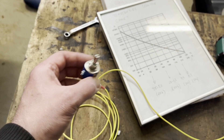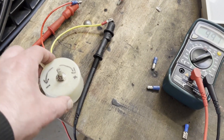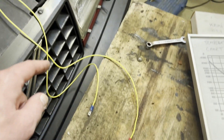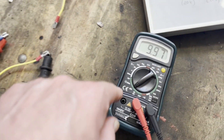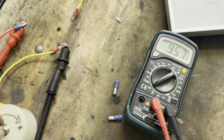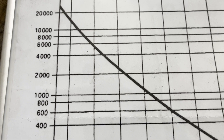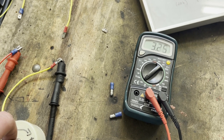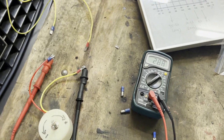I built a bracket for this so it's much easier to connect to the sensors. I used an old spray can cap as a case - there are two wires coming out and I connected my multimeter. There's a connector already fitted. It shows 9.97k ohms on the 20k setting. When I turn it to the left the resistance goes down. By the chart, 20°C is about two to three thousand ohms, so I'll take it down to there.